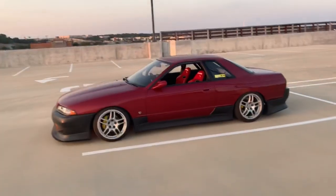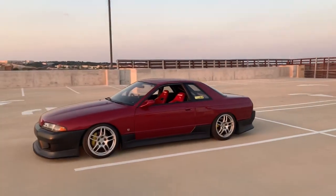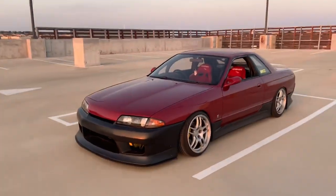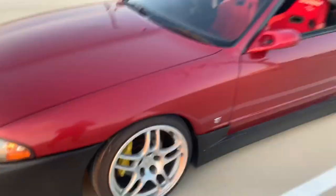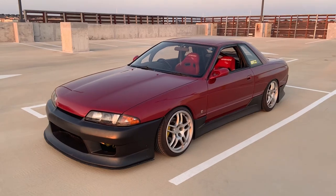There's actually a dent on the fender now — a couple dents. That was my fault from pulling the motor and tranny — the engine swung around and hit the fender. I have fiberglass fenders at home but they don't fit that well and I'd have to run more spacers up front. I'm actually running GK Tech 15 mil bolt-on spacers up front — they're very small bolt-ons with extended studs so you can stack slip-on spacers on top if you want.